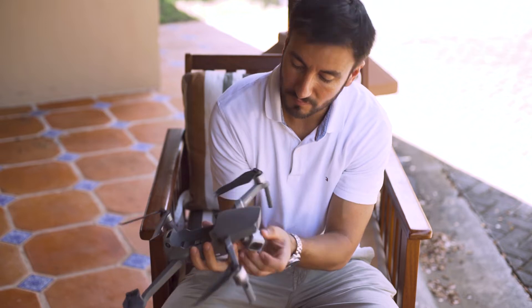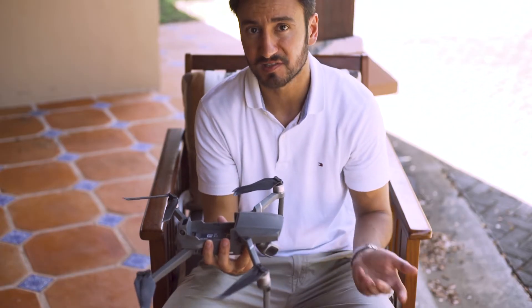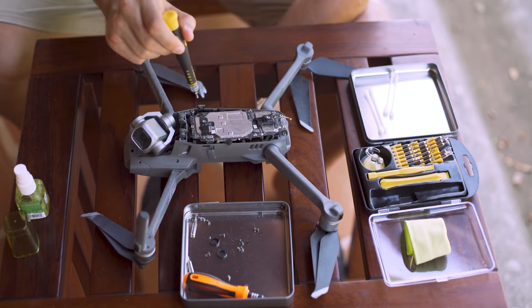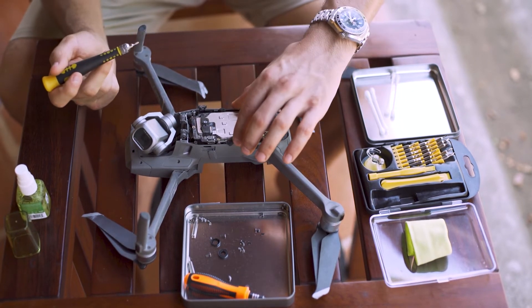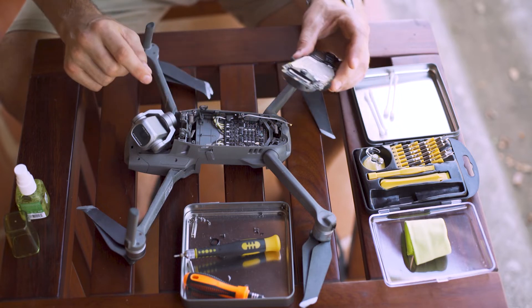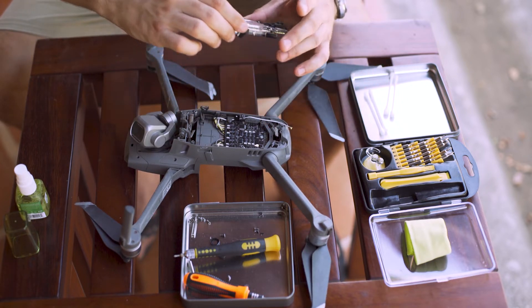What I'm going to do is take off the base and clean it with alcohol very gently, just to wipe away any salt and dirt from the muddy water. I took off the plastic cover on the base, and then very carefully took off the electronic panel. The screws on this panel are all Phillips, but the screws on the plastic cover are a different sort — a hexagon kind of shape. You've got to be really careful: there are six little connectors plugged in here, and we have to lift them up very gently. I don't recommend putting it back in the rice after you've taken these out, because if dust gets inside that's not going to be good.